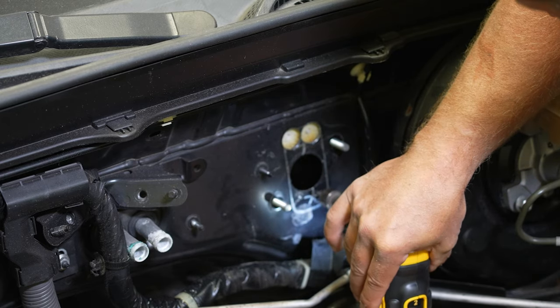All right, so I'm gonna opt for the cutoff wheel method. I just feel like I can maintain a little more control and placement of my line. Just remember, you got some important stuff around here like the harness and this brake line, so just be careful what you're doing, take your time. But we got both sides freed up, so now we just got to get this top and bottom cleaned up here. This will break off, but we'll be left with a little point.